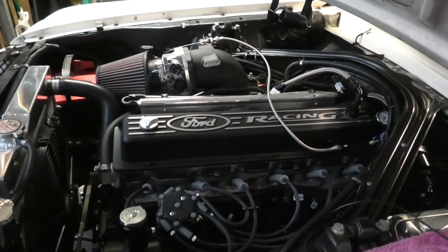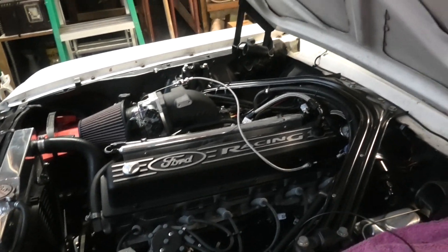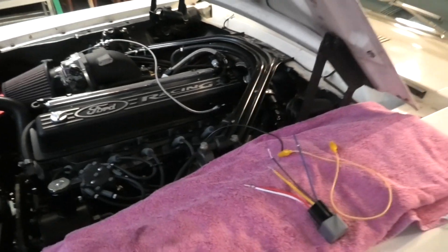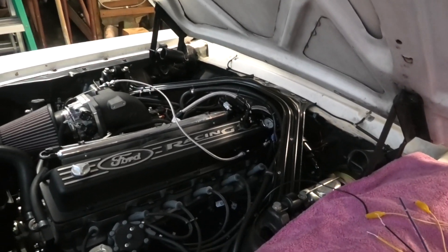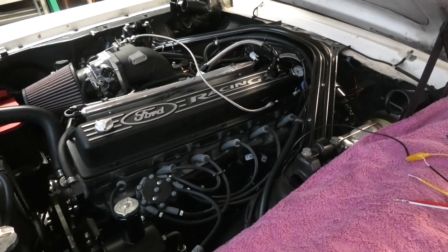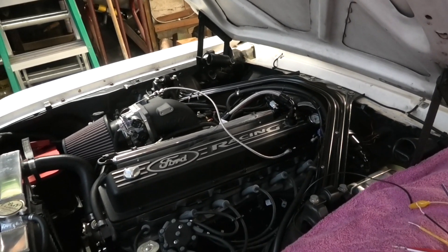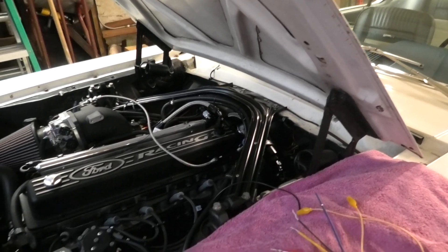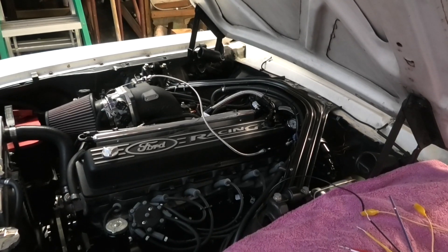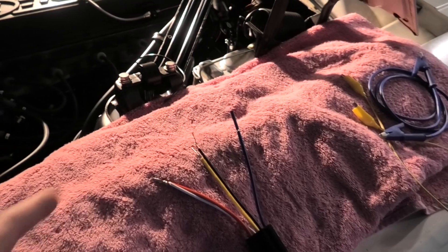As far as going into gear, once it's in gear it idles great. The other thing I did — which I didn't feature in a video because I had a literally four-hour window — is I changed torque converters. I went to an 1800 to 2000 stall torque converter, which helped the idle quality in gear immensely. This engine, the way this cam ended up, was a little bigger than I wanted and it was lugging — that stock converter just wasn't quite enough. Big shoutout to Champ Converters — Jason over there built me a converter and shipped it to me. I popped the C4 out in an hour and a half and had it back in within two hours.